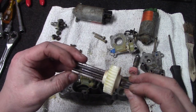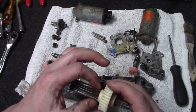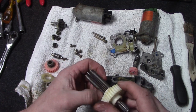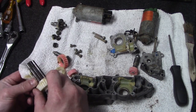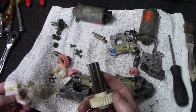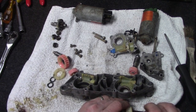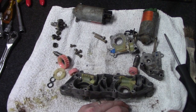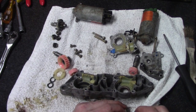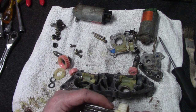We can do something about that surface rust on that though. This is exposed. This part sits in the track. Yeah, most of it's wiping off, so we can clean that up pretty easily. Spread a little converter on it, let it do its thing, and stop it from corroding anymore. It looks worn though.